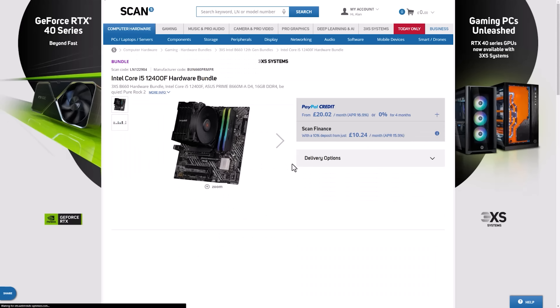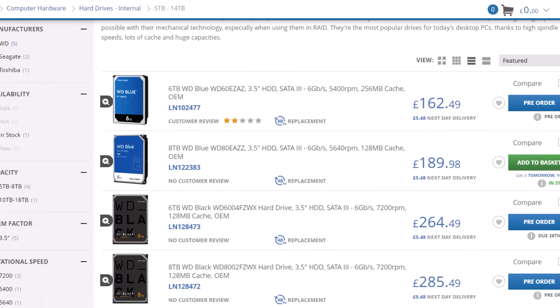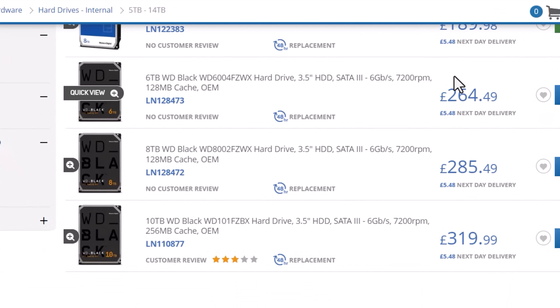I'm not going to put together a parts list because things move so quickly it will probably be out of date the minute this video goes online. The key takeaways if you're going to build your own home server are: one, get a server case first that meets your requirements and then order components that will physically fit inside; two, make sure your motherboard is compatible with your RAM and CPU — computer stores often sell bundles with all three pre-installed so you know they'll work; and three, computer equipment often goes up incrementally in cost until it hits a certain point and then shoots up dramatically, so see if it's worth stretching maybe $50 or $100 more to get a better bang for your buck.